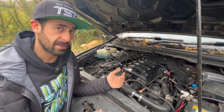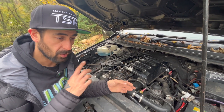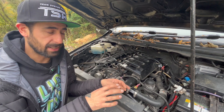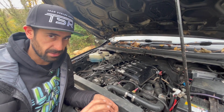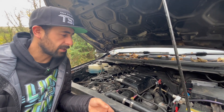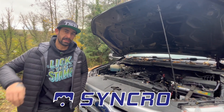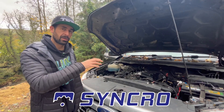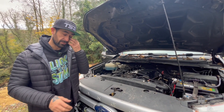Engine mounts are really simple. The rear end is completely standard — all your original Ford stuff, you don't need to change anything there, or the prop shafts. For the engine mounts, they're just custom fabricated pieces — really easy to make up. You just use a rubber donut or engine mount of your choice and fabricate a bit of steel work to go to either side. Pretty straightforward stuff. In terms of adapters and Synchro products on this car, it's running the BMW auto and BMW engine.